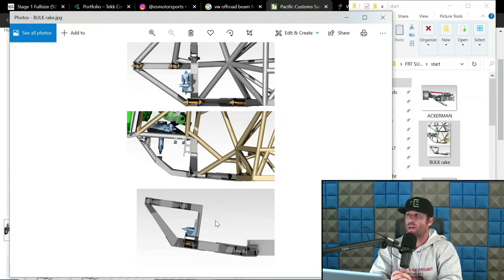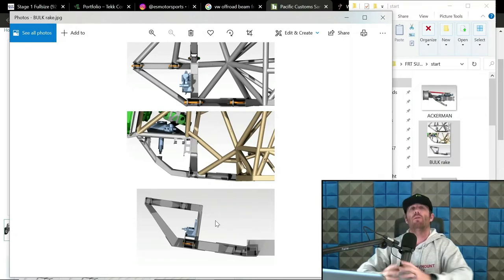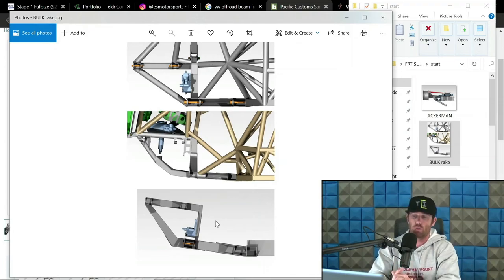The cool thing with that too is it's a little bit easier to build. Everything is straight up and down. All the shock towers, all the mounts, all the tubing, everything, fixturing, tooling is all very simple and perpendicular. So when you add rake to it, it's raking everything. So your shocks will follow the direction of the lower arm. So if the lower arm has 4 degrees of rake, your entire shock package is now raked at that angle as well. Same with some of the other bits like the steering and things along those lines. They all get raked into the equation, no pun intended.